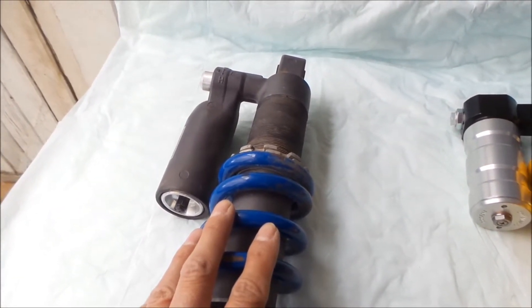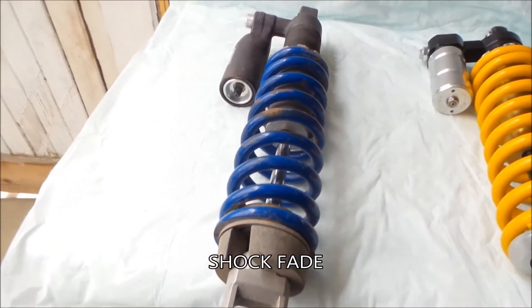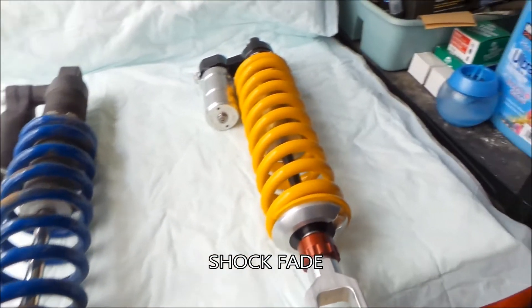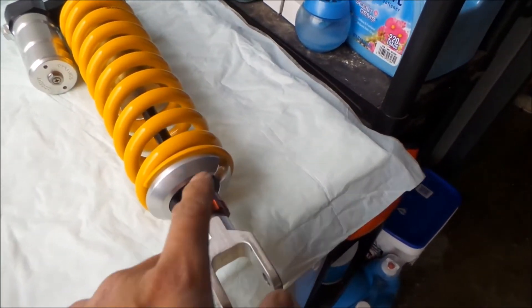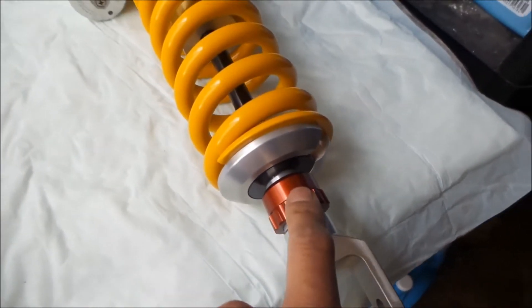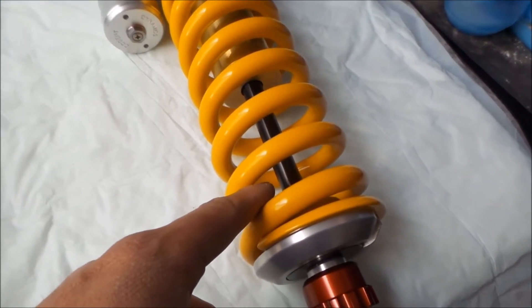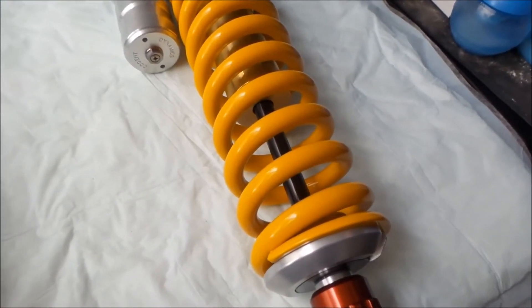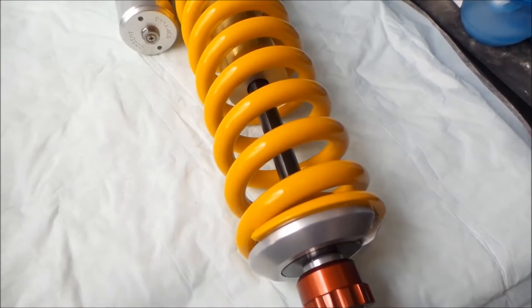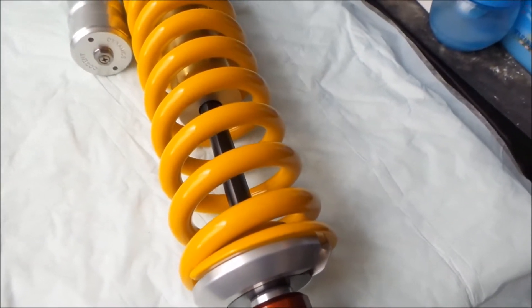On this one, if I ride it off-road for maybe an hour or so, you'll notice the damping starts getting squishier and squishier — you'll notice its performance dropping. The Mojave Pro also features an adjustable rebound adjuster on the shock shaft. It has a diamond-coated shock shaft which is supposed to be a lot harder and last longer than the stock.